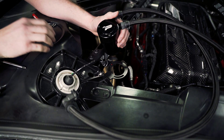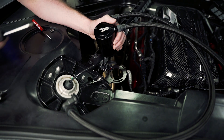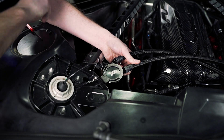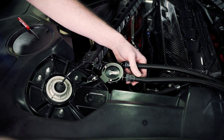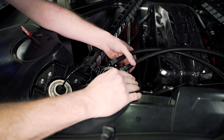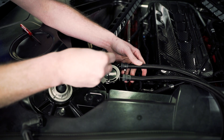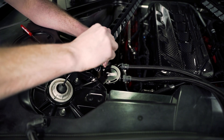Now that we've got the catch can here, you've got two screw options: black Phillips head ones and stainless steel Allen headed ones. We're going to use the stainless steel ones. Slide the catch can underneath here, line everything up, and install the screws. On the coupe, this is going to be rotated so the hoses run parallel with this bar. On the convertible, rotate it the other way so it clears the coolant reservoir. The hoses will reach for both cars. We're on a coupe so we'll orientate it back this way and tighten them down. These are the two and a half millimeter Allen screws — for vibration purposes, put just a tiny bit of blue Loctite on these.